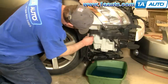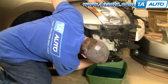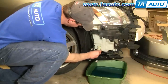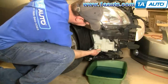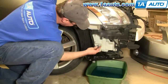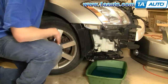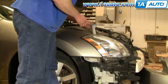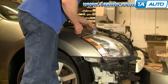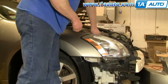Put the washer tube back in and put the clips back on. Reconnect the sensor. Make sure the motor is going into the grommet and then push the motor in firmly. Reconnect and make sure that we reconnect our washer tube. Take your fill tube and put it down in — it goes kind of like that with this part facing forward. Push it down and then turn it clockwise to lock it in place.